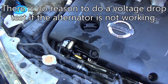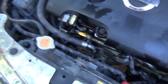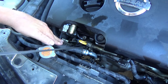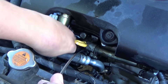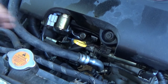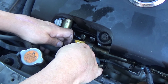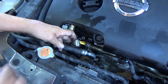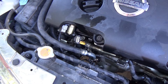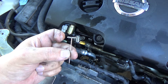I can't really reach down there to release the connector, so I'm going to tug on the wire while I depress the connector latch — and there's the connector. The reason you want to verify all this is that if you had a wire issue and went through all the trouble to change the alternator, that's a lot of work to find out a brand new alternator didn't fix the problem. A T-pin works great here — get yourself a little box of these, very handy.